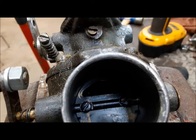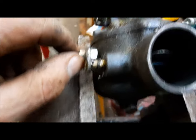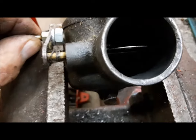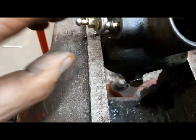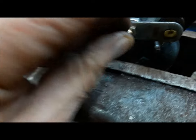Also, this little pin is the stopper for the choke when it's open, and you can see it's letting the choke go all the way past center and start closing again. That open position — it's letting it go too far — that is going to disrupt the airflow through the carburetor and possibly make this thing run fat.